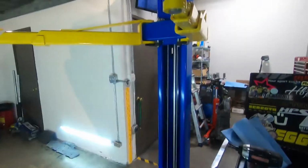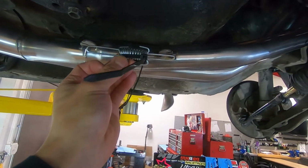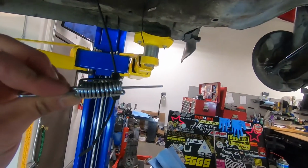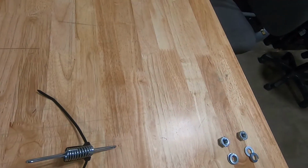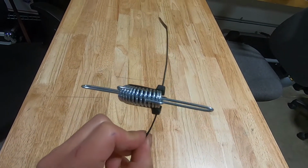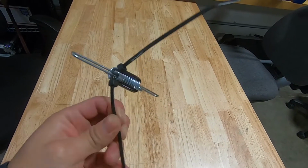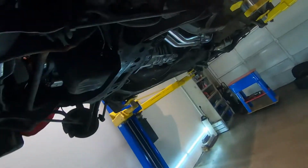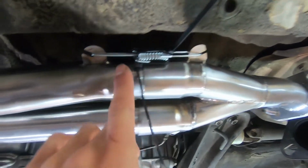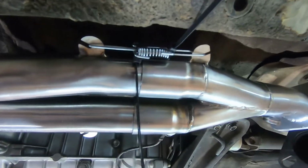These slip fit springs used to be a nightmare to install until I learned this zip tie trick. So what is the zip tie trick? You use 2 zip ties on each side of the slip fit spring to keep the spring compressed. And then you slip on one side, get your needle nose pliers out, and you should be able to just hang it over pretty easy.